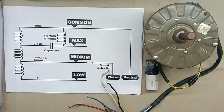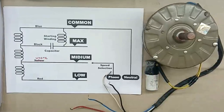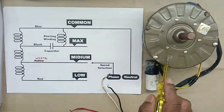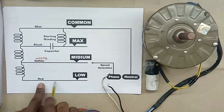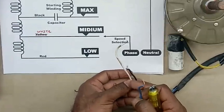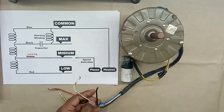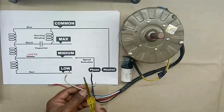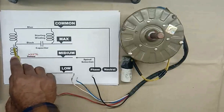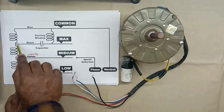As I told you, since blue wire is open, and blue is connected with the neutral power supply, if the blue common wire is open, we have to repair this motor. But if red wire becomes faulty — red wire is for low speed — then without using red wire, the remaining two wires, black and white, can still run the motor. Through black wire we can run it at maximum speed, and through white wire at medium speed. Low speed will not work, but the other two will. Similarly, if white wire becomes faulty, the motor will work on low and maximum speed. If black wire becomes faulty and the capacitor is connected there, then medium and low speed will work — but if the capacitor connection is open, we cannot run the motor.